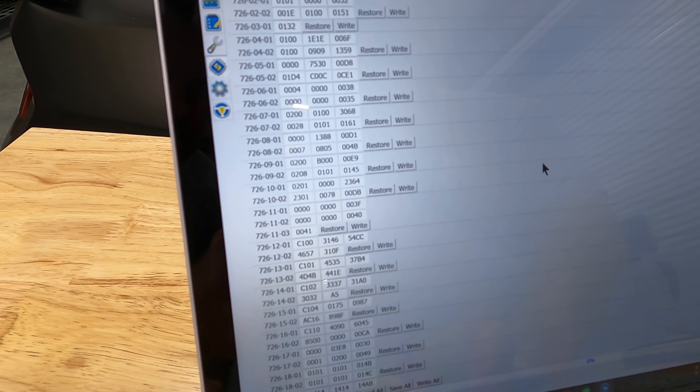You would change some of these digits - we'll show that to you in a second. There's a seven-page document that is going to be way more detailed than any video I'm going to make. We're going to put a link to the how-to-use-FordScan document in the description, and I recommend that you read that twice before you start programming anything. Understand what's going on - things have to be done in a certain order or you can tear up your truck and brick it. We don't want you to have a messed up module and spend a thousand bucks to replace it just because you were playing around in FordScan and didn't know what you were doing. That's your final warning.